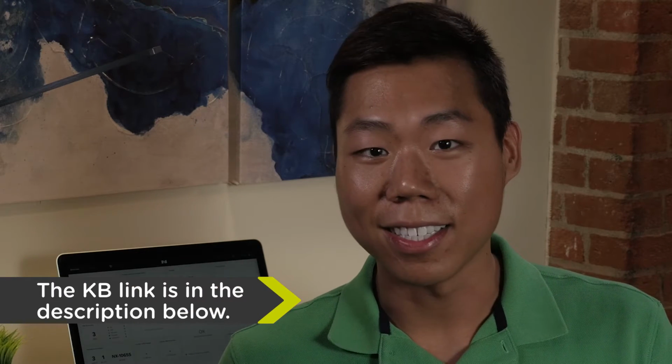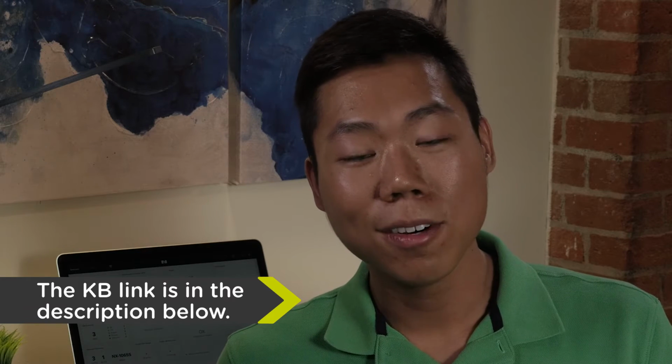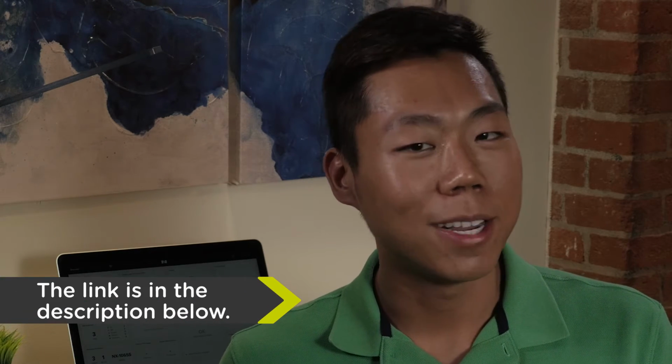Today I'll be talking about the SATADOM and the simple cloning procedure we use if we ever need to replace it. If you've recently upgraded to the newest version of the Nutanix Cluster Check or NCC, you may have recently seen a new alert saying that your SATADOMs have a PE cycles of above 4500. Please refer to Nutanix Field Advisory 38 for more information on this.